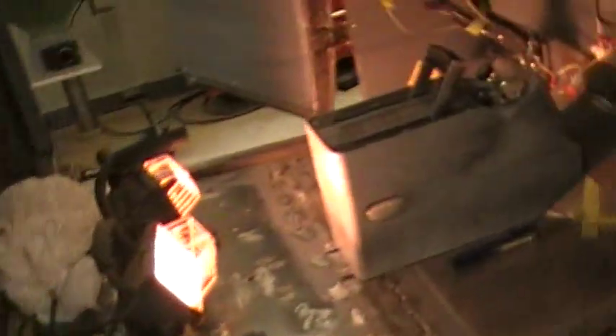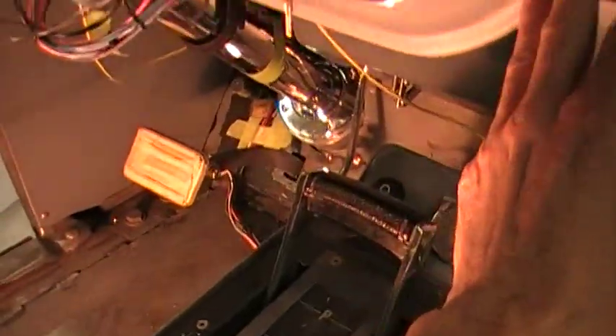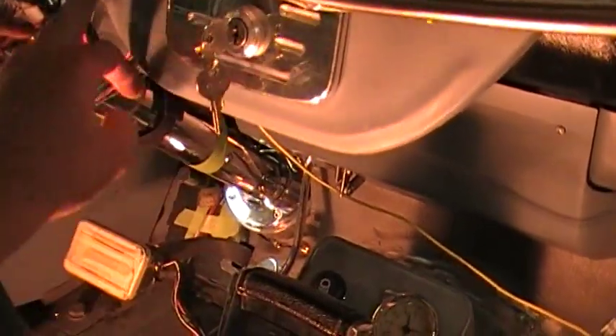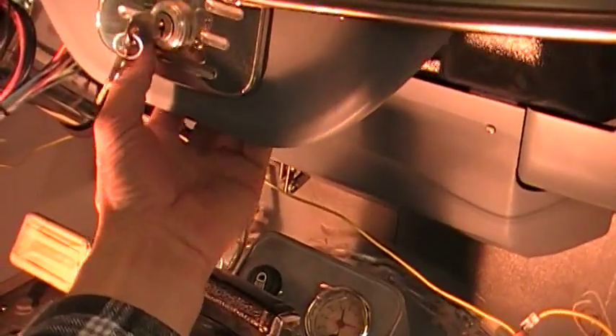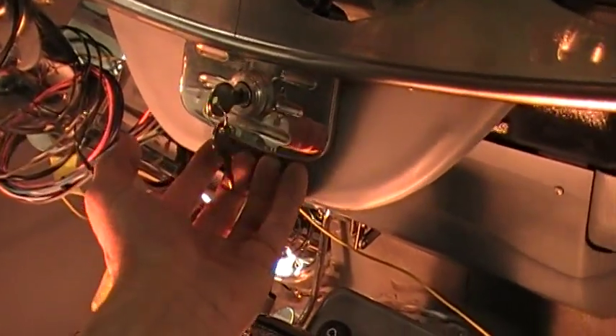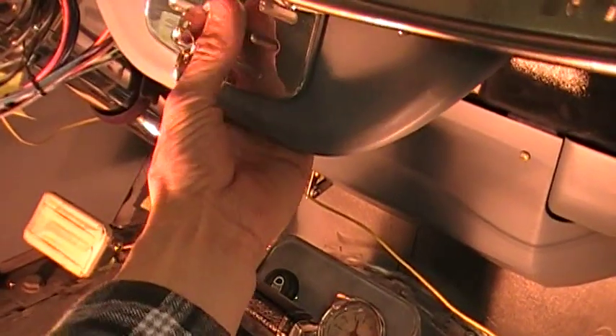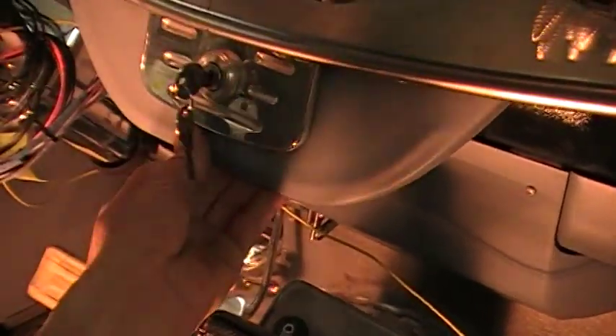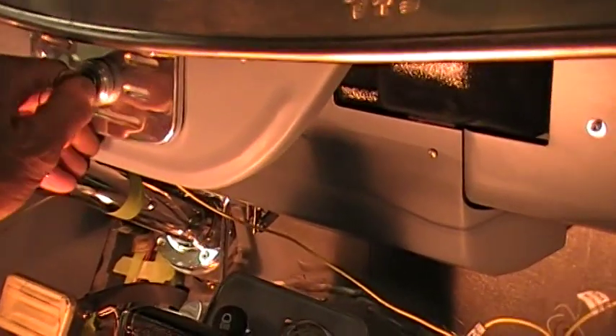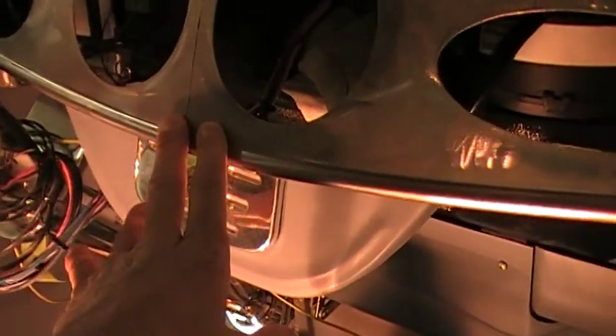I bought that bead roller for doing more than just one thing, but the main reason why I bought it was to build this pod in here for my ignition switch. I bead rolled it and then put a return flange on it and mounted it in here. This is what I've been wanting to do for a while — I never liked the way this looked just by itself. What actually holds it on is the ignition switch, and then I picked up a couple mounting points up here to hold it in place. It makes it look a lot better, and it'll get finished out with the same paint details as the dash.